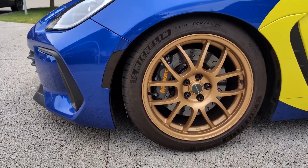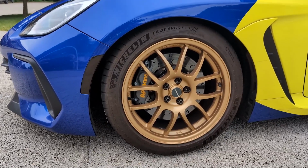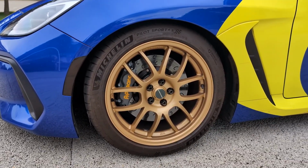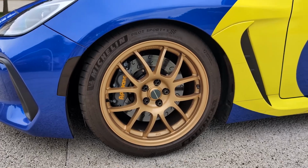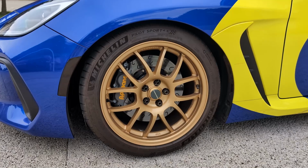We finally did big brakes. So we did the AP Endurance series, not the Sprints. Hopefully those end up being beefy enough for the track. For daily driving, we're doing Ferodo DS2500s. Those will work for autocross too. And then for the track, I did the DS1.11s.